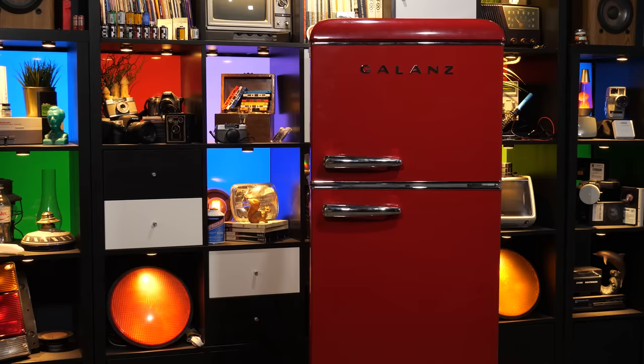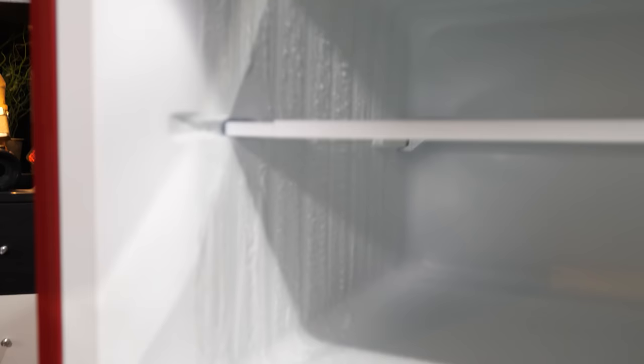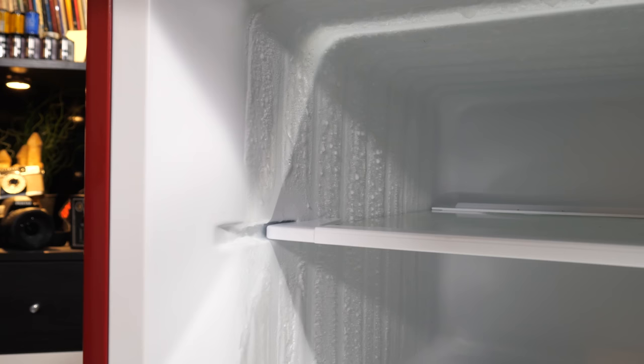Also, this fridge only gets to claim partial automatic defrost. The freezer compartment does build up an ice layer on the walls with time. In my experience this was pretty minimal, however I was using the fridge from January to June, so the bulk of its use was in the cooler, drier parts of the year. Because the refrigerant lines are behind plastic walls, you can use a plastic ice scraper without doing any damage. In fact, it even came with a little one for this purpose. Plus you can leave the fridge running and maintaining proper temps while you defrost the freezer section, so that's a nice bonus.